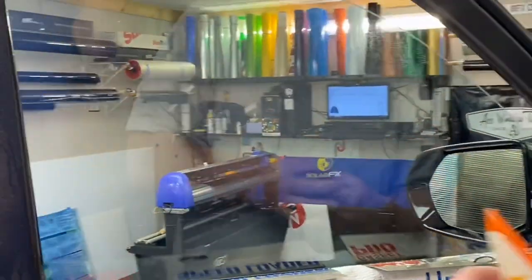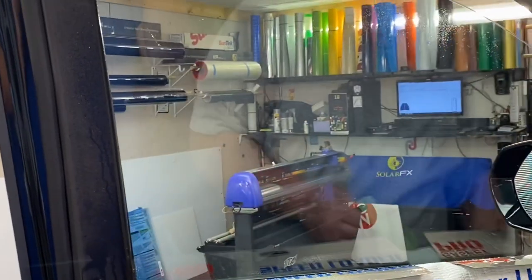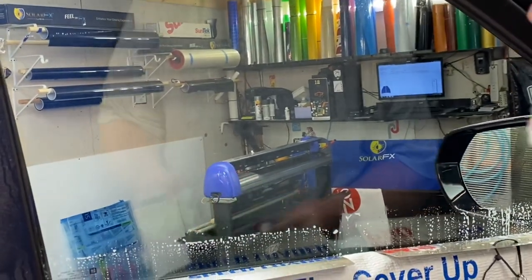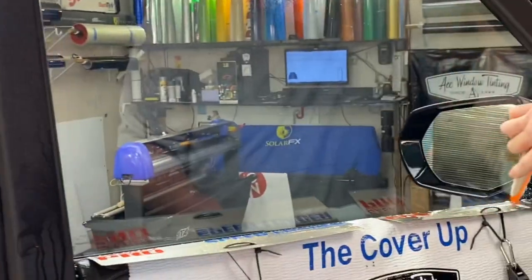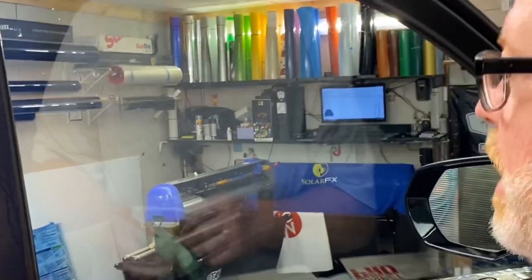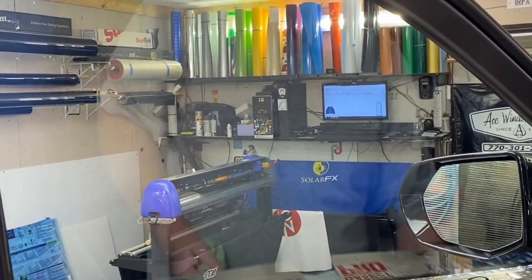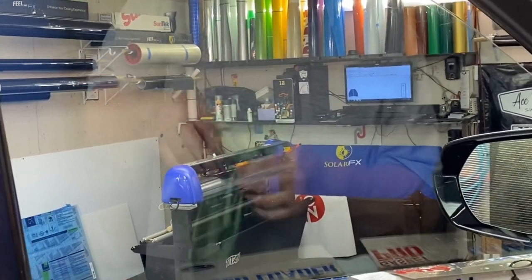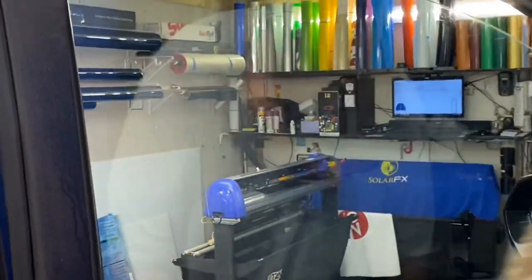We're utilizing our new Judge blade, print blade, and this Sidewinder. You can order different blade durometers in these same handles. Now, anybody who tells you you can prep with something harder than say an 85 durometer — you probably can, but it's not recommended. A squeegee prep and clean squeegee is designed to have a little grip to it in order to pull the contamination off the glass.